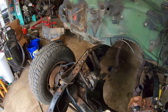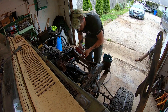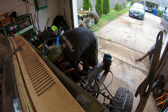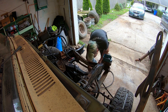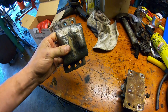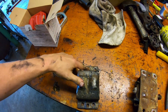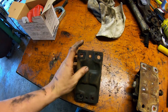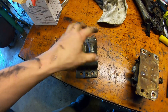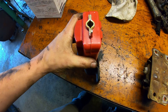The next thing we're going to do is get our clamshells pulled off the frame brackets. So we're at the workbench — this is our passenger side clamshell mount. From the factory, they do a little quick press rivet here and here. All you do is drill those out from the back and it'll allow you to separate the two pieces of metal. Then your new motor mount goes right in there.